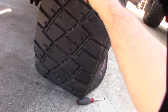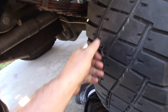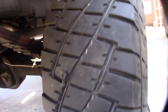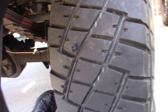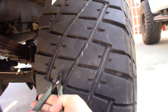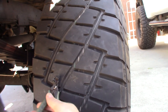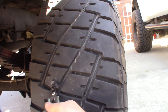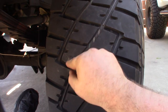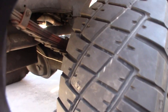I've got to keep opening the hole and get the plug past. I do a quarter turn and pull out. These are wire cutters to trim it. That was difficult — I didn't expect this to be easy, being that this tire is really thick. I hope that works. Let me fill this thing back up. It's super gluey, super rubbery, sticky.